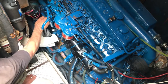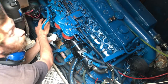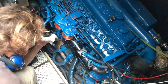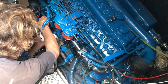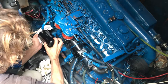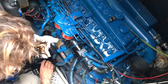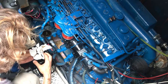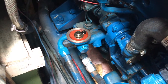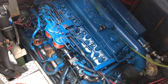You can remove the oil filter using either a strap wrench, or the way I do it — with your bare hands. Just squeeze really hard and twist as hard as you can and it'll come off. Now this step can be really messy if your filter is inverted the way mine is, so if anyone knows of a clean way to do this step please let me know in the comments below. Then just clean the base where the filter was attached to remove any remaining oil.